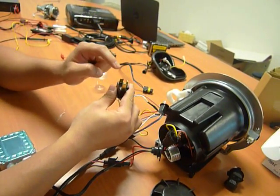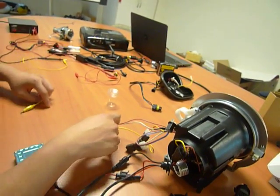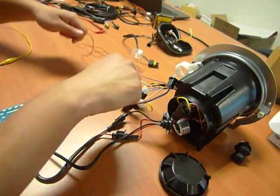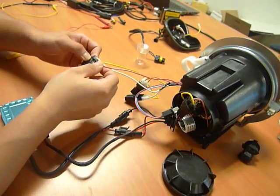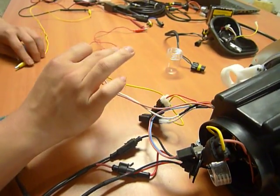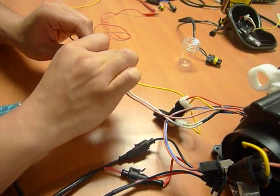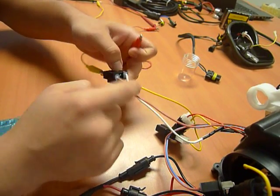You've got your one negative and then a low beam and a high beam function, which I'll be showing you on hand via bench testing, to confirm this as a test on your side when you're connecting this to your vehicle. So using an educated guess, it's safe to assume the brown wire is the ground. So I have that grounded. Additionally, I have my positive, which I'm assuming should be high beam, and this should be low beam.